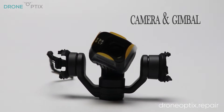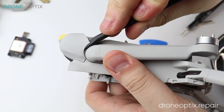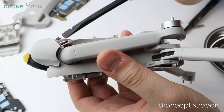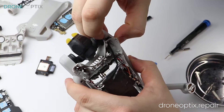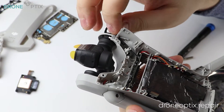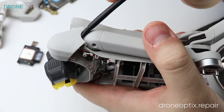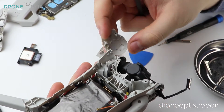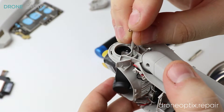Next up I'll do the camera and gimbal. The corner plastic covers have no screws and require just some patient prying. Once they are off, the connector can be pulled through and by using one of the motherboard brackets, I carefully push the rubbers out taking the gimbal off.